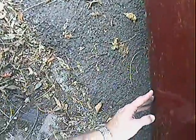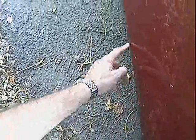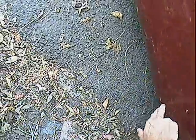On the passenger side here, we do have some localised bubbling from there all the way along to there, right on the lip of the door skin. And there's some bubbling under the paint in a section just there. But again, the sill to wing joins are all correct and open the way they should be.